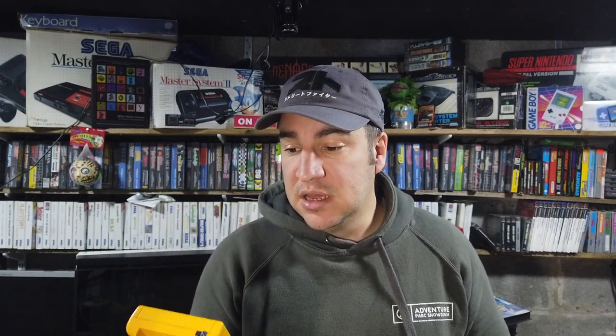The quality and condition of it generally is pretty good. The start and select text has rubbed off. But the ultimate goal is not to use this case — I'll keep it because I really like the DMG Play It Loud series. I'm going to be using a different case and a different screen in the end system. Dane sent this through and says it's got no power at all. He's had it for a while in one of his boxes. We're going to test it out with some batteries, then look at whether it's the screen or the main board not working. We'll clean it up, check for faulty parts, and hopefully get it up and running first.